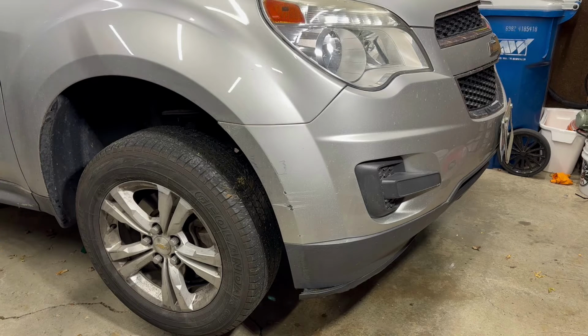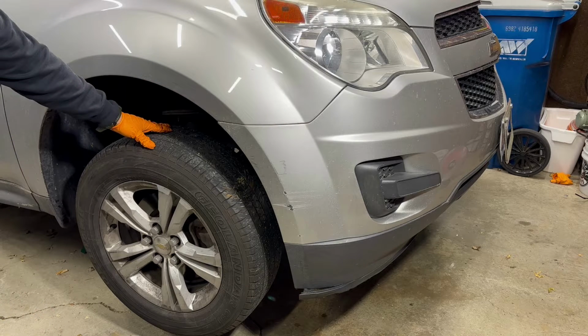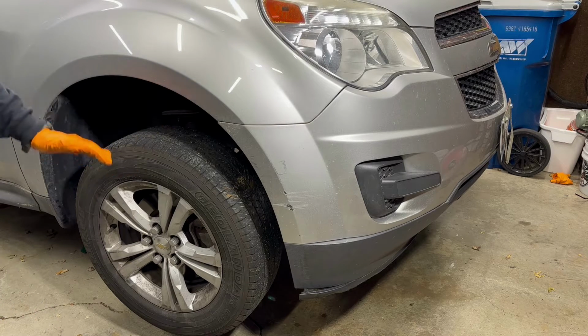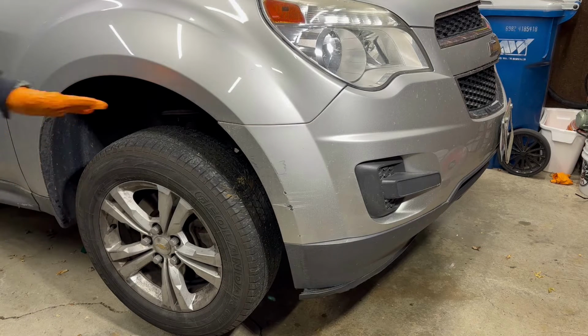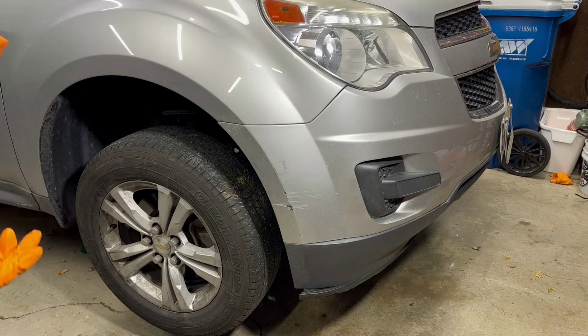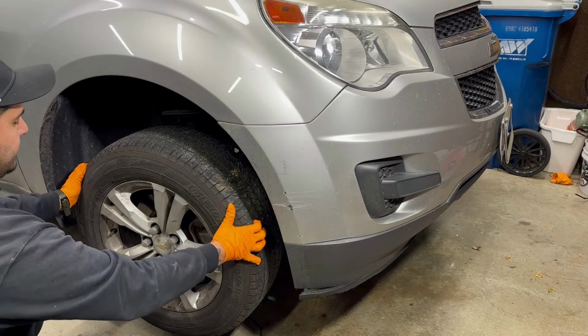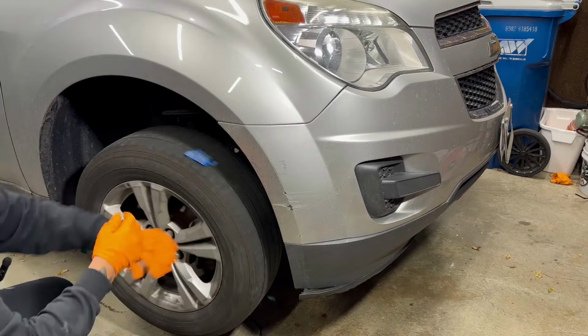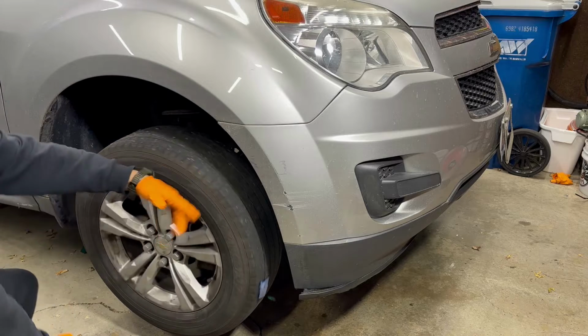First, you might hear a noise from inside the cabin, which resembles a roaring noise, which we have. Also, you sometimes notice your tires are unevenly worn on one side. That can also point to a bad wheel bearing. It can also be a control arm, but we already replaced control arms on this vehicle. The third one is sometimes you'll have a wobble, and this one's pretty solid. So definitely our noise is coming from the actual bearings inside, so you can actually hear that.